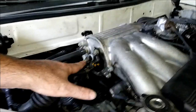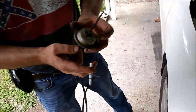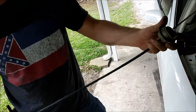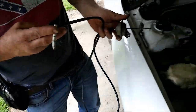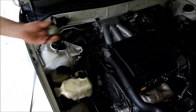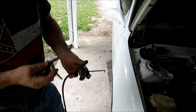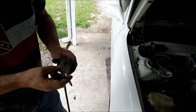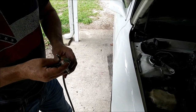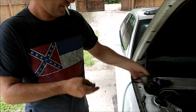This rod connects here, it bolts here, and this is called the actuator, which is just a diaphragm. To see if yours is working, disconnect your little vacuum hose here on your diaphragm, hook an external hose, and give it a little suction. In this case I got nothing — I must have big holes inside, because it's supposed to retract with vacuum to open that induction.